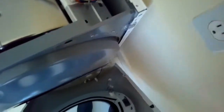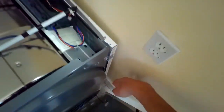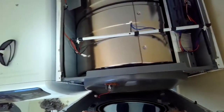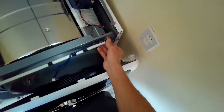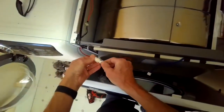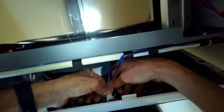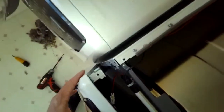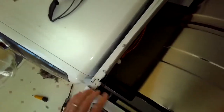We're going to reconnect the lid switch modular connector in the bottom right corner. Before installing the front panel, take the wire housing and put the plastic clips back into the manifold to hold the wire housing in position. Reconnect the connector for the dryer light, then put the blue wires back in — that's the controller connector. Then lift up on the front panel, get everything lined up, push it firmly against the frame, and start adding the screws that hold on the front panel.